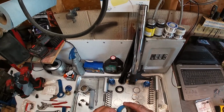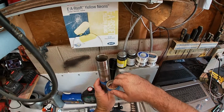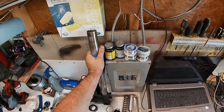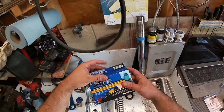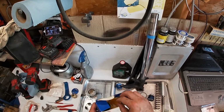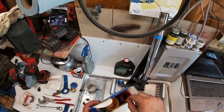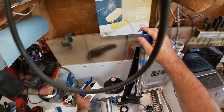So, first, I'm gonna put a layer of tape over these breather holes. This reduces, maybe even completely mitigates the possibility of scratching. Those holes are fairly smooth, but I don't wanna risk it. Then I'm gonna use Motion Pro's fork seal bullet set. Probably the green. Yep, actually it's one smaller. It'll be the blue probably in this case. Yep.